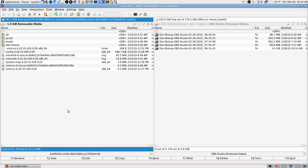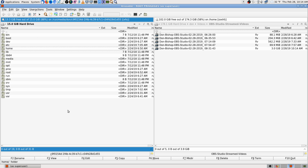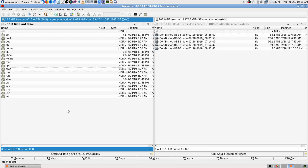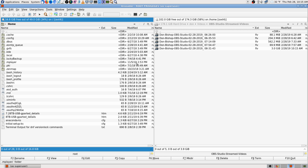That's weird. Because that boot, if you were in a running system and you went in there, assuming you have permissions like I'm using root mode, then you would see the files just like that. But for some reason, when you mount them in USB sticks or SD cards, it'll do things like that. Don't know why. So anyway, everything is there. But when he said that about partition table, it got me to thinking. You can't just write a partition table to one that's already there, because it will erase everything.